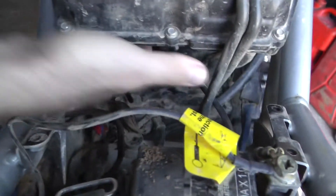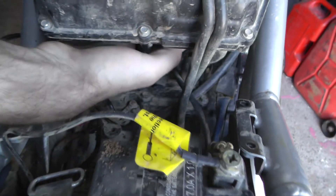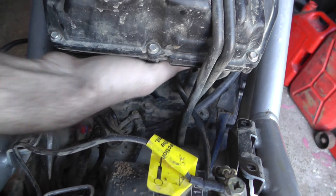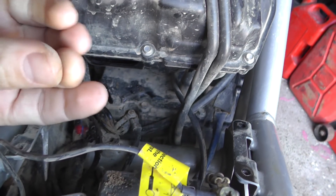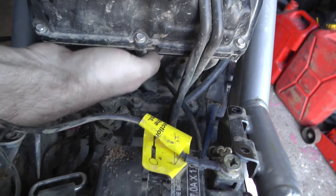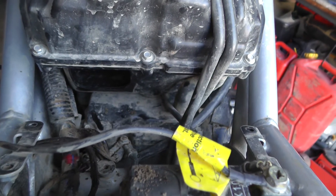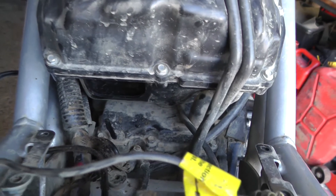While you're waiting for your cock sock to dry, the other thing you can do is just feed your hand up — you'll feel the bottom of your filter; this is the dirty side from underneath. Just rub your fingers across the fins — clean as a whistle, mate. That pre-filter is working a treat. That was caked on with mud and dirt after the last nav ride, so as far as I'm concerned that's the best thing I've spent — I don't know, 70 bucks, whatever it is.